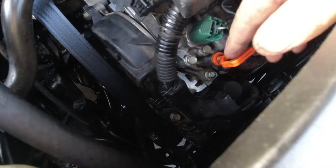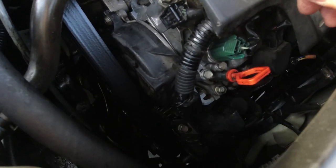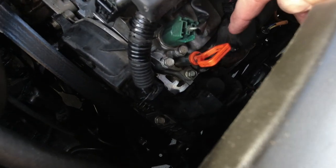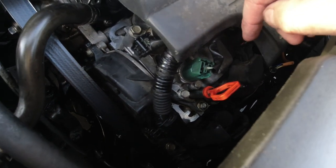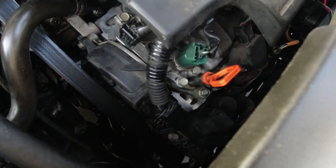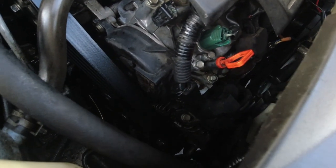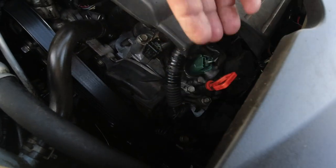There's still a little bit of a leak. I don't know if this tube — this dipstick tube — has some kind of gasket around it or something, or if it's the corner of the valve cover gasket. I did buy a valve cover gasket, I just don't have the time to do it right now. So maybe it's leaking there — I can't tell. I just drove it from the shop to over here and it's a little bit of oil right there.